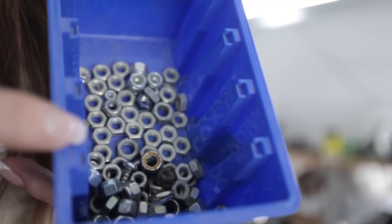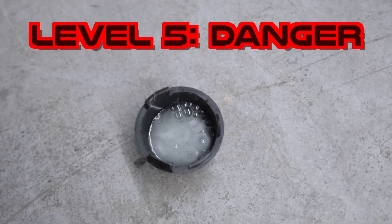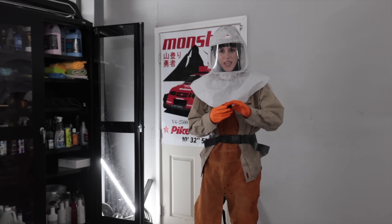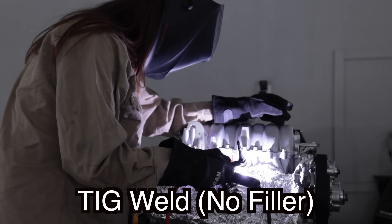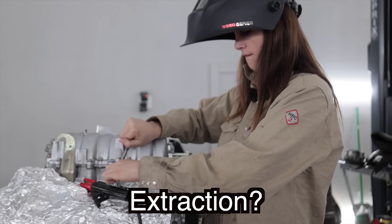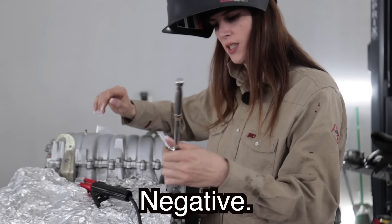I'm burning all the zinc off the nuts. Rinsed them off — zincless nuts. Here it goes. I think it's going... I think I just broke it off. Damn! I have just enough material now to try this one more time, and if it snaps, it's gonna be snapped flush off the head and I'm gonna have to drill it out. This is something that should have been done at a machine shop when the engine is completely torn apart, because if I get any trash in the engine trying to do this 18 times...